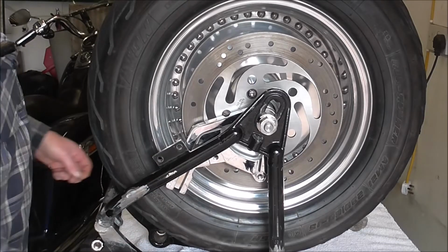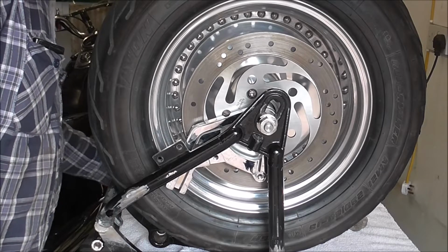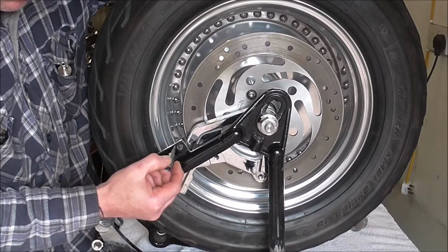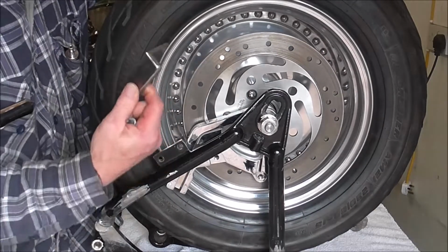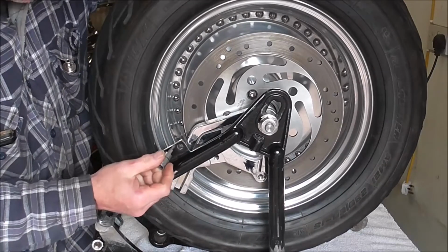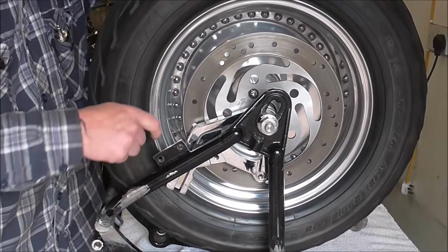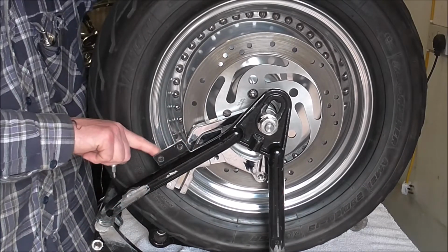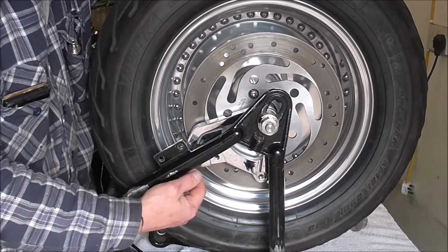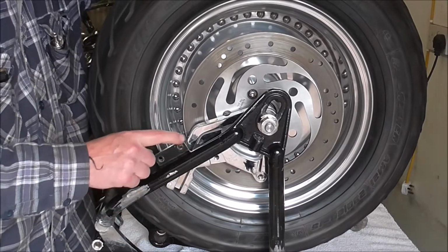Now this stub here is going to be cut across here, because where this goes in, it sort of comes across that way, and then it'll be cut down there, and I'm going to utilise this bracket. I'm going to fully weld around the bracket, and then on this side I'll just put like three 10mm stitches on, which is more than enough to hold that bracket in place.